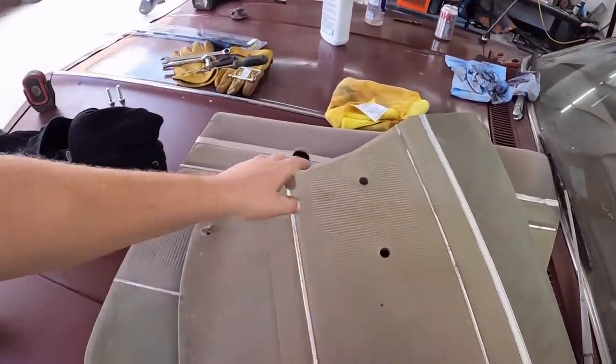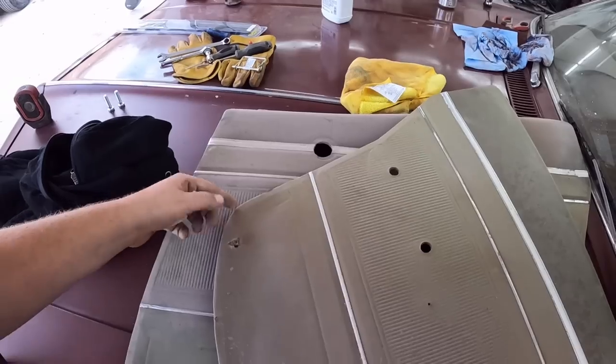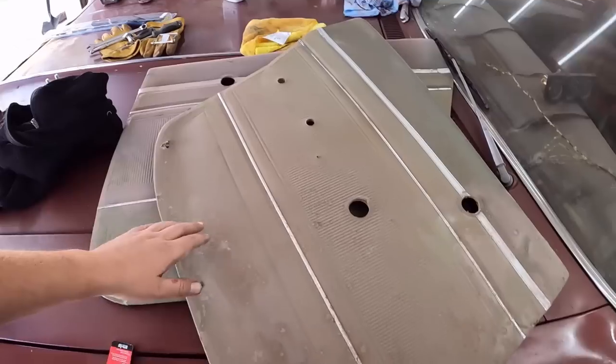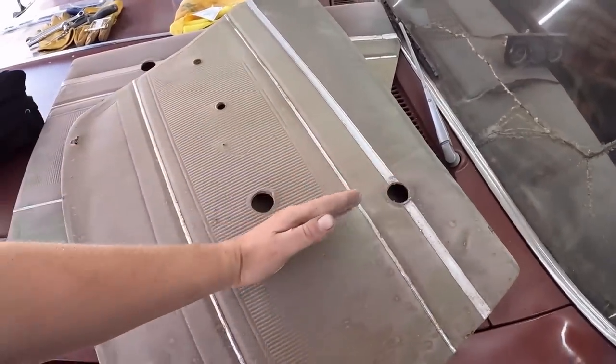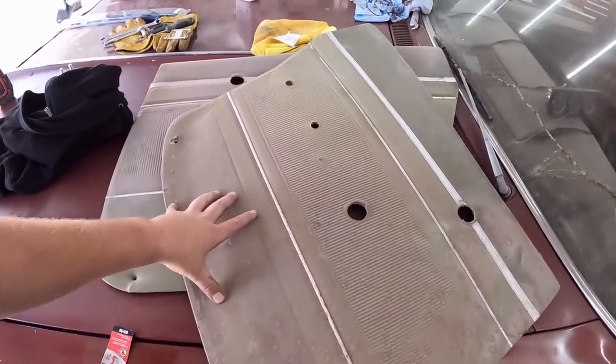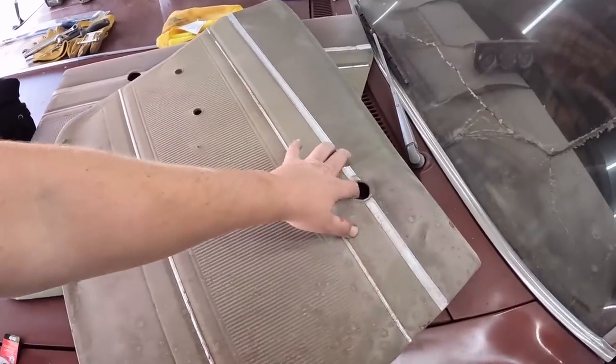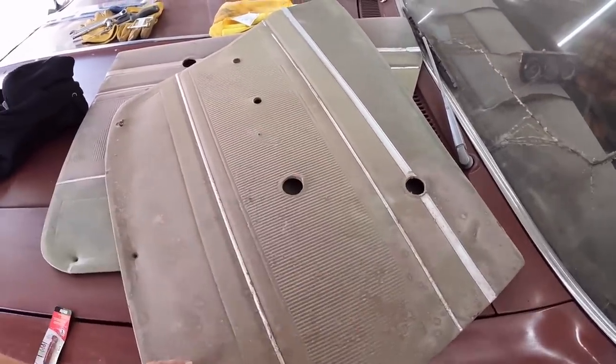This is what I've cut out, so we'll just kind of make that work by shortening it down. Then we have the factory rear door panels — this is probably driver's side — it's got the kick out for where the door would open. So the seat would fit up around there. I think what we're going to do is shorten it like that, put it on there. We'll be able to put a door handle back on if everything lines up, and then put a plug or some sort of silver dollar in there, make it look nice.